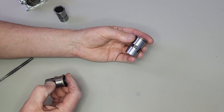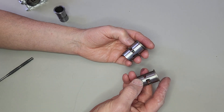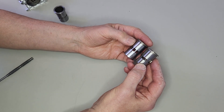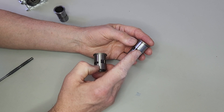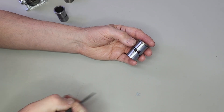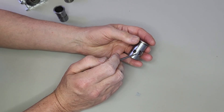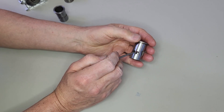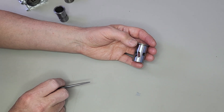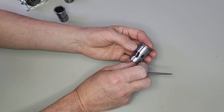On the Leslie V12 prototype we used a Fox 40 cylinder liner. Our engine is a long stroke engine, whereas most model engines are short stroke high-revving engines, so you can see the difference in length here — the Fox 40 was quite suitable for our motor. You can take note of its exhaust, its inlets, and its boost ports. It has an unusual design on its inlet ports; I'm not sure why — it could just be for manufacturing purposes.